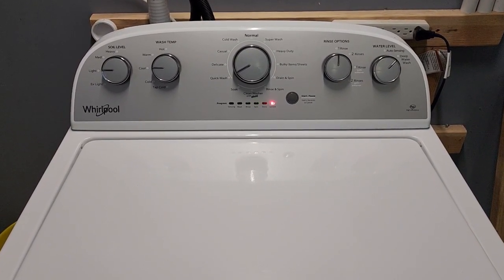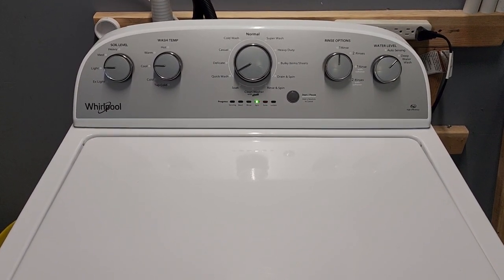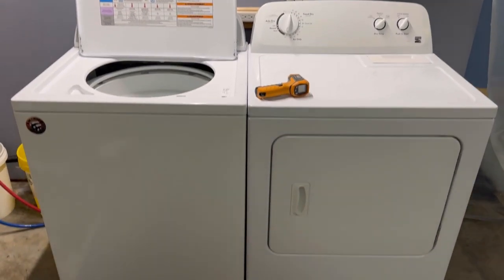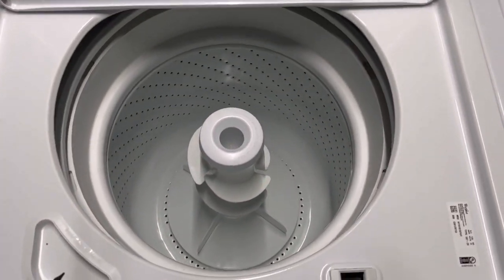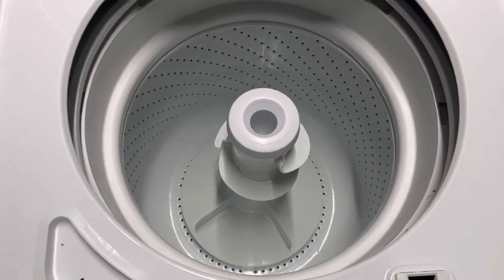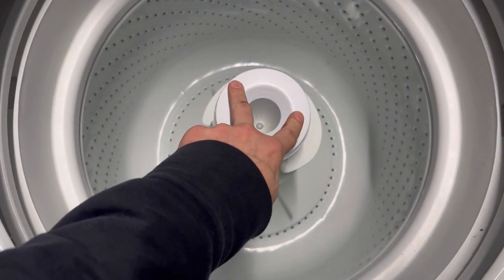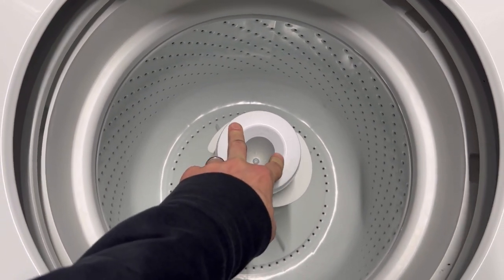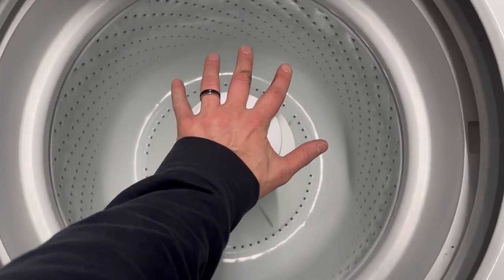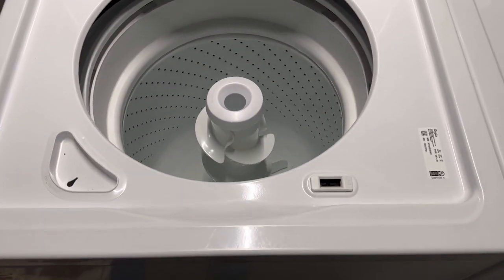This one finished up pretty quick and did an excellent job. Now we've got the washer cleaned out — nice huge capacity on that. About the agitator: you can't spin it back this way, but you can spin it freely this way. Another good tip: if you want to make sure your shocks and suspension are good, reach down with a couple of fingers and push on this tub. You'd know it was bad if it started bouncing like a basketball. Here I'm putting all my weight on it and can just barely budge it — that's what you want. But if you push and it starts bouncing, you might look at having your shocks replaced. All of that checks out and it's all in perfect shape.